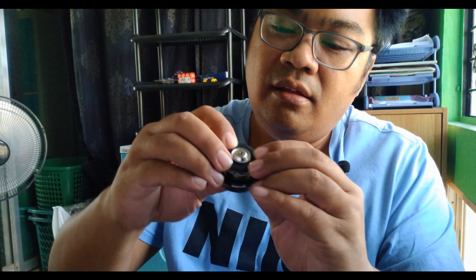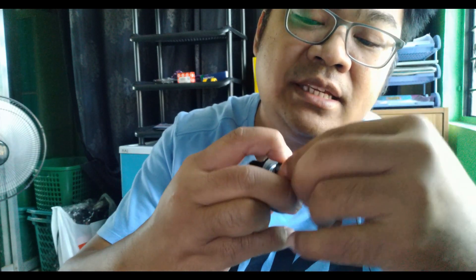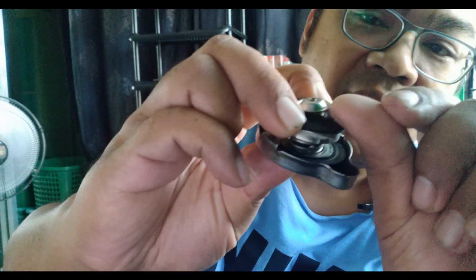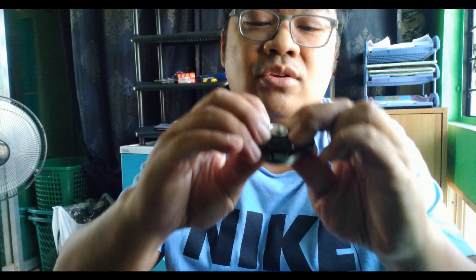The rest goes down your radiator, releasing and cooling down the coolant while retaining atmospheric pressure within your radiator. Once everything cools down, the vacuum valve — this tiny plate — opens up, and the coolant from your reservoir flows back into your radiator and goes into the cycle again. Once you reach the 16 psi limit, the valve opens again, and so on.